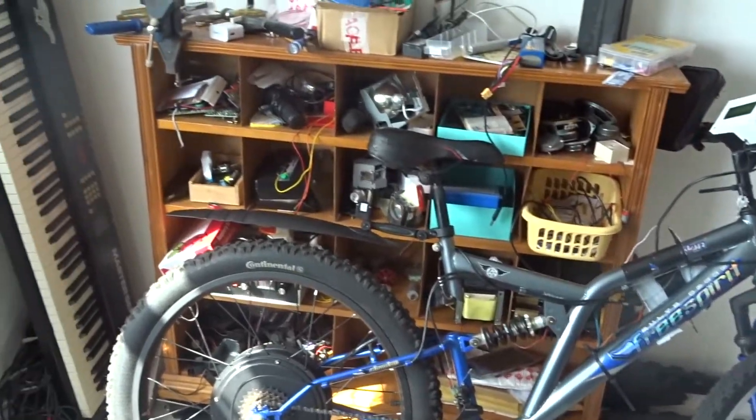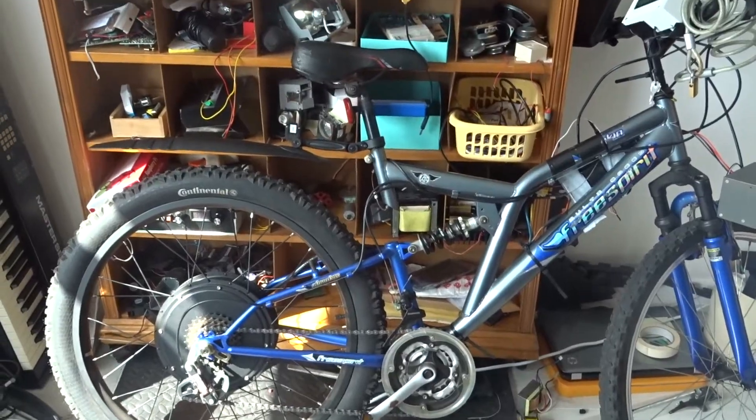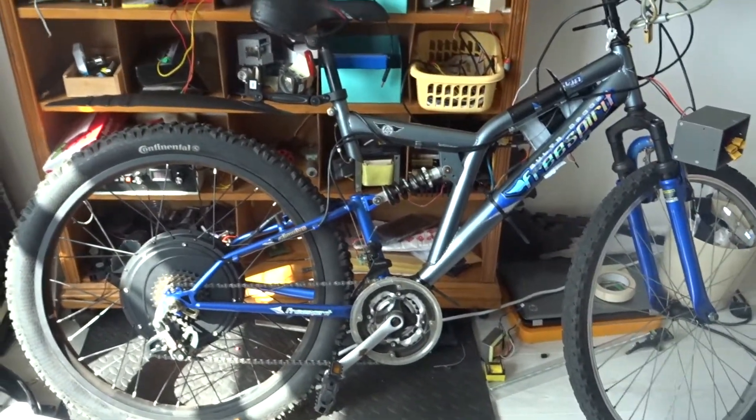The main benefit of having sensors on a bike like this is it gives you an easier start when going from standstill. Without sensors, you'll notice it stuttering and being very jerky — occasionally it will just stall. So sensors really help with that. However, at higher speeds sensors can be a bit of a hindrance because it slows down the whole working of the bike, since it has to check the sensors and then apply the voltage to the motor.